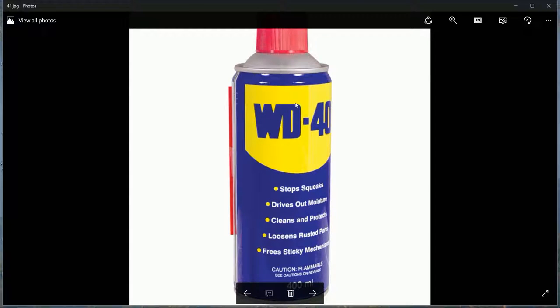Get a selection of oils - WD-40 is your minimum. Contact spray is also good as it cleans and improves electrical connections. Brake fluid should be on your list too, as well as electrical contact cleaner, which is a fast-drying spray that's very good for MAF sensors.